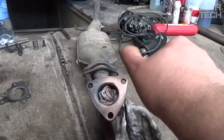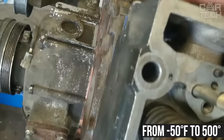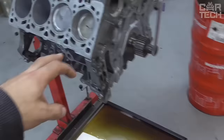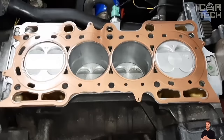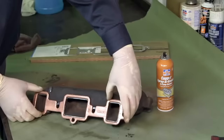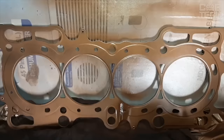A versatile high-temperature spray sealant. This compound is specially formulated to seal joints exposed to high temperatures from negative 50 degrees Fahrenheit to 500 degrees Fahrenheit. It is ideal for exhaust system gaskets, cylinder head connections, turbochargers, and other hot components. The sealant forms a strong copper film that fills all surface irregularities, providing complete tightness and preventing leaks. Application is elementary — spray the compound on the joint and let it dry. Apply on clean, degreased surfaces. Aerosol packaging allows quick and accurate application of the required amount.